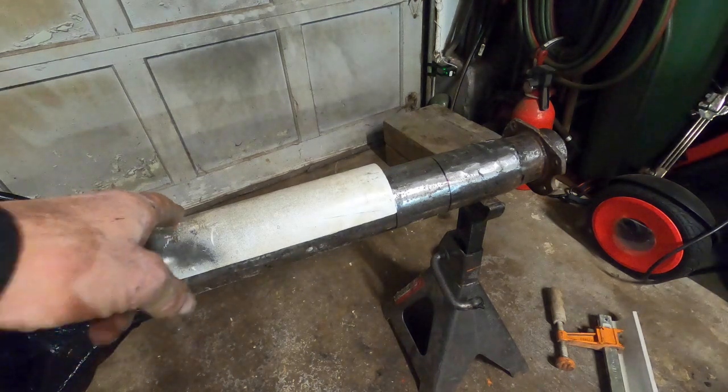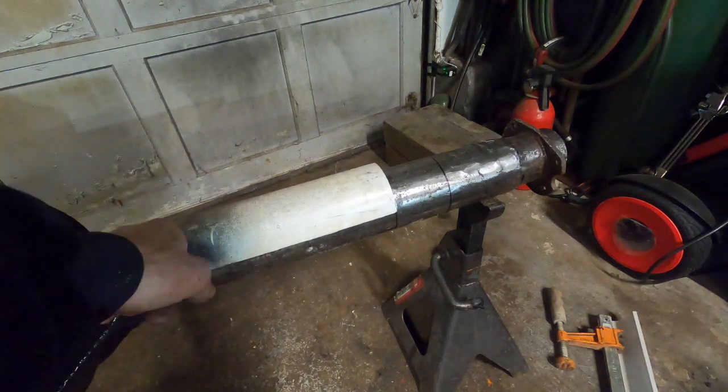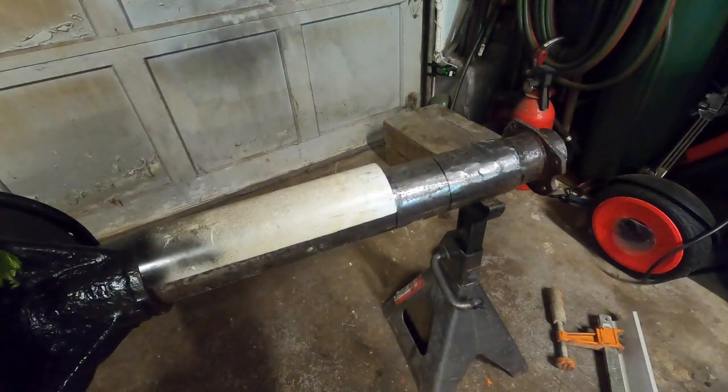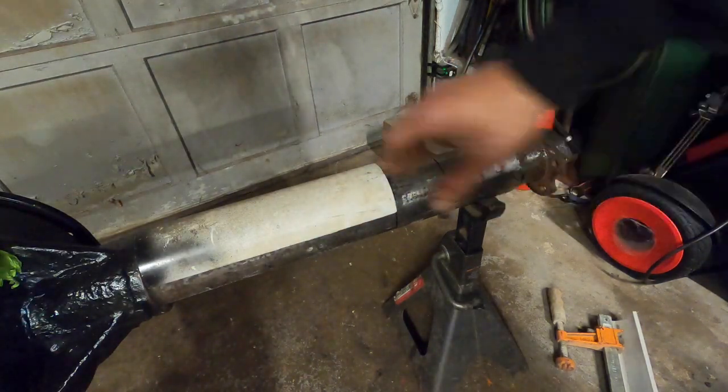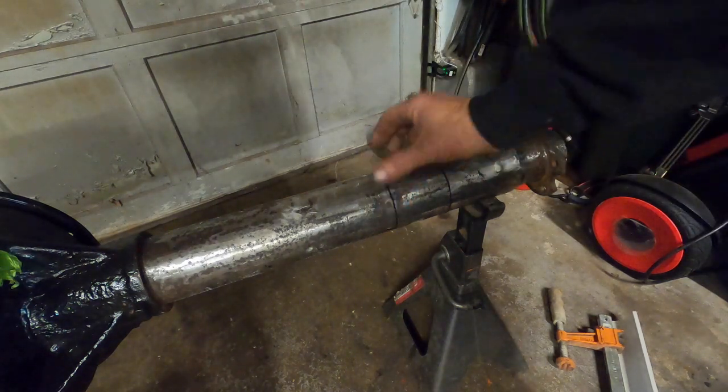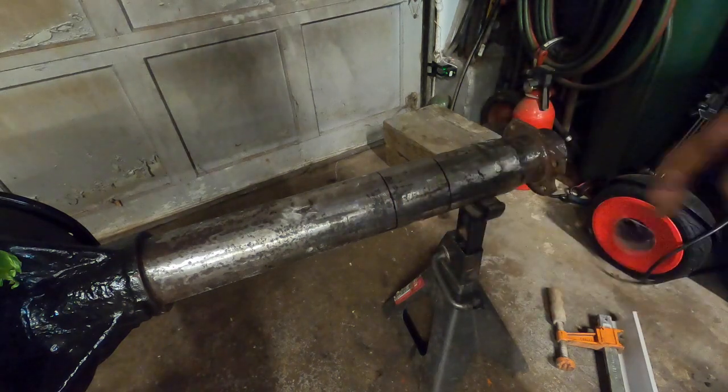I cut a couple of pieces of PVC. You guys seen that earlier? At 11 1/16 of an inch. That's gonna be the center of the perch, spring perch, when I'm done. Cut, and that's where it's gonna be welded together.